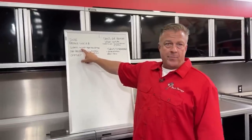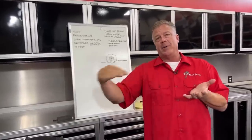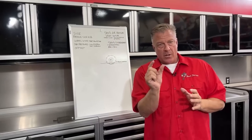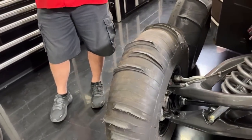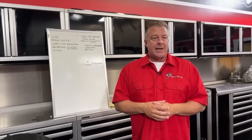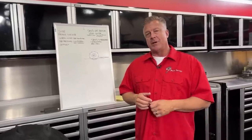Wheel width: for the most part, the wider the wheel you run, the more square the pattern of the tire will be where it touches the ground. A straight paddle on a very wide wheel tends to have less forward acceleration but more slideability into a corner — you can pitch a flat pattern tire a whole lot more into a corner. If you go with a narrow wheel and stack that tire up to make it round, it will have less tendency to slide but more traction going forward. Round tires also tend to follow grooves in the trail, and a lot of guys who haven't been to the sand before come back saying the car goes everywhere — it's probably following the tracks depending on paddle size, air pressure, and how round or square it is.